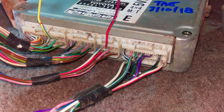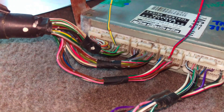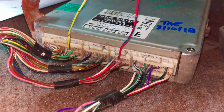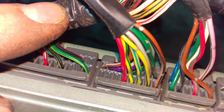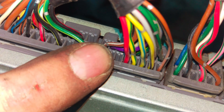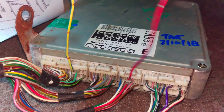What I'm going to do is depin this ECU, take this wire out of here, and then put it into the other harness. For the idle wire — that's C11 — I have to do the same. That yellow/blue is the old cruise control ECU from the TPS, which is also tied into TPS, and then it goes to idle. So we're basically going to cut this and move it over to that pin once we depin it and move it to the other connector. We're just moving that wire and adding this one.